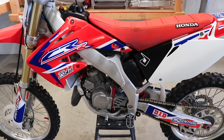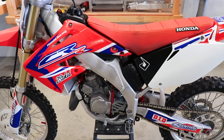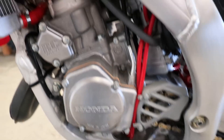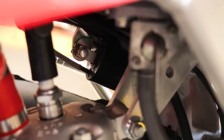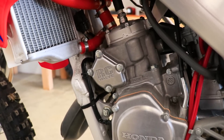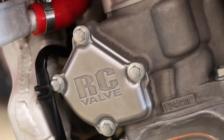If you've been through all that and still haven't solved the issue, I would start digging into the electrical components. If you have an ohmmeter and a service manual, you'll be able to test the stator, which is underneath the flywheel cover, and the ignition coil, which is usually tucked up inside the frame. Unfortunately, the CDI box is something that cannot be tested. If your bike has an exhaust valve, check into that next — a misadjusted, sticky, or dirty exhaust valve will definitely cause some issues.